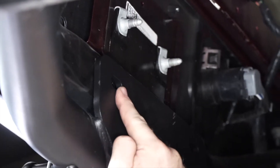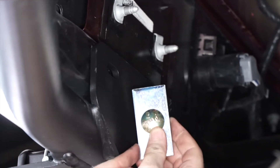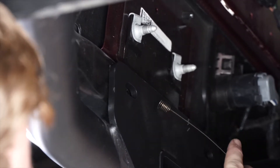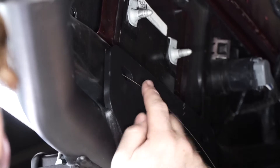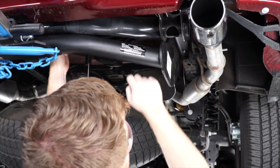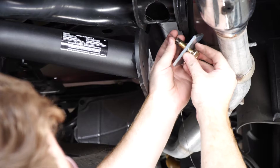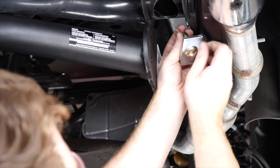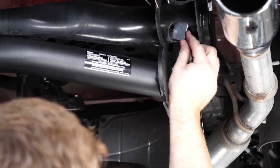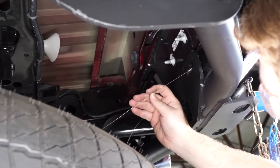Now for our two attachment holes behind the hitch, we're going to need to bring our carriage bolt and large spacer block into position. To do that we're going to need to fish wire, so we'll take our fish wire that is included with our kit and push it into the holes, then push it to the outside of the vehicle. It'll follow this tube until it comes out of our access hole. Then we'll attach our carriage bolt and spacer block, throw our block in first, and we'll repeat on the driver's side.